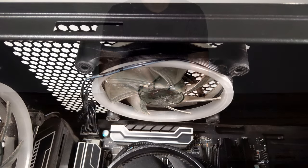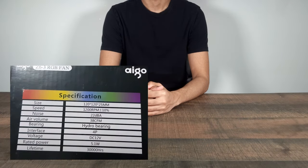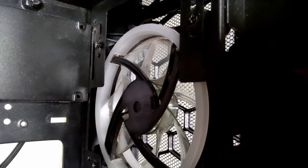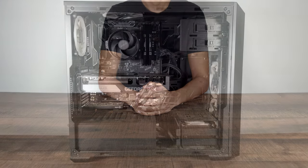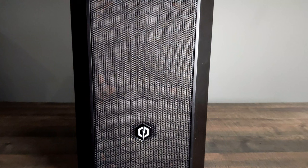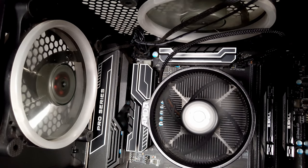We'll start with my current fan setup, which is these Ego fans that I bought back in 2018. They're not anything special — I'll have the specifications show up on the screen. Currently they are very dusty, and I kept them in the same condition for the benchmark. However, I used the same configuration again for my next test but with the dust removed. There are 4 of them in total, 2 serving as intake and 2 as exhaust. This creates neutral or slightly negative pressure, since the filter at the front makes it a bit difficult for the fans to pull in air. The RGB was kept off during the test.